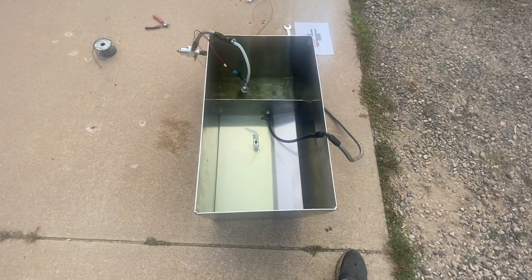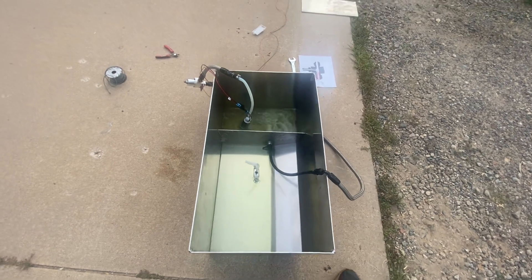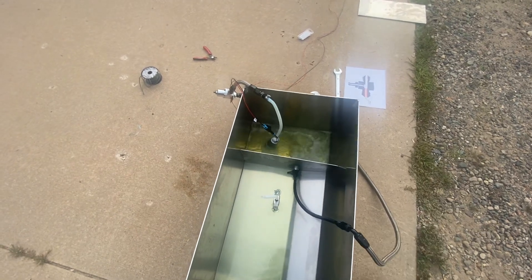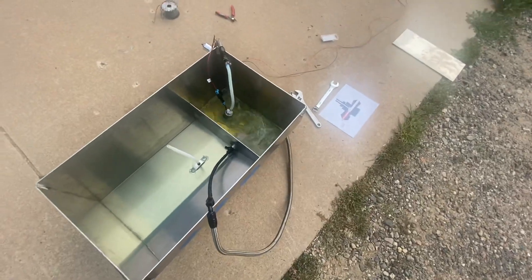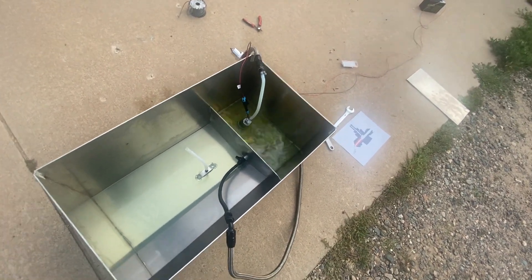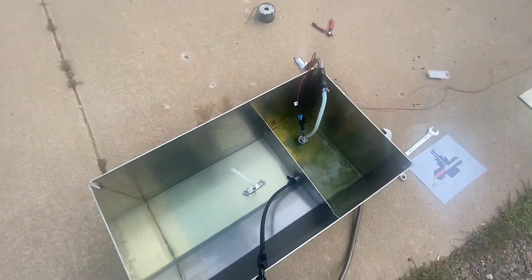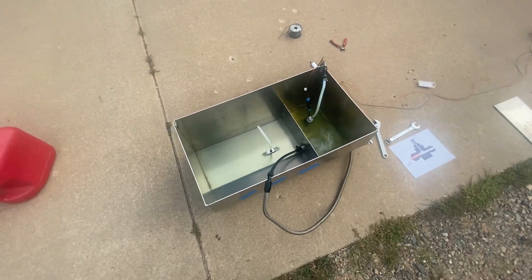The idea is that we can now use all the fuel in the tank — we'll pump the front well dry and pump it back into the reservoir around the pump. Since the rear reservoir is a small contained area around the pump, we can pump that out to where there's only about a half gallon of fuel left in there. That works great and should really solve any fuel starvation issues before they happen.